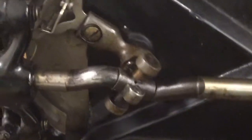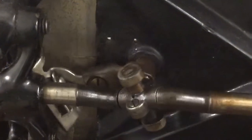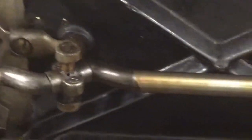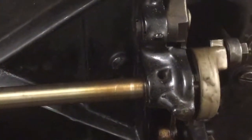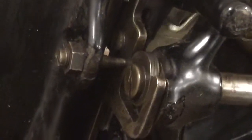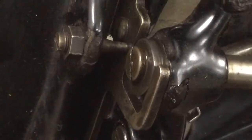But this toggle action, for lack of a better description, is what produces the vibrating motion of our shuttle carrier there. And it's derived from this lower lay shaft here that's driven by this connecting rod and sliding block assembly. And then of course a dwell cam here at the other end produces the fixed up and down motion of the feed dogs for producing the 4-motion stitch.